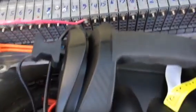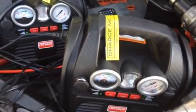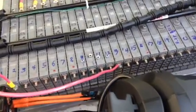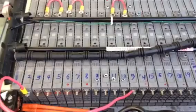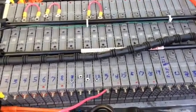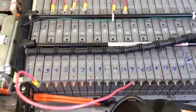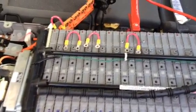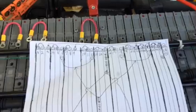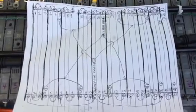Right now I have these two brand new jump starters from Costco hooked up in series to make a 24-volt charger. I just finished charging the entire bank and all 28 cells are synchronized at about 8.2 volts each. Here's a wiring diagram on how you can charge an entire Prius battery — that's how to charge an entire Prius battery with our homemade 24-volt charger.